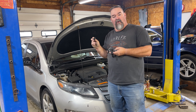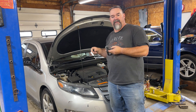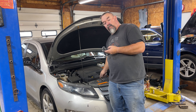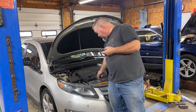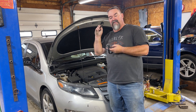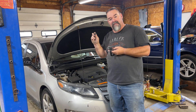So there you go — 2014 Volt, battery coolant side. If you get a battery coolant or 'service high voltage system' code, come check this battery coolant level. It's on the passenger side — make sure it's almost at the top. It seems to want to live slightly above the black bracket. If it's low, you can add a little bit. If it's not low, chances are this sensor is your problem. I'm Dave with Absolute Car Guys — thanks for coming along, enjoy the ride.